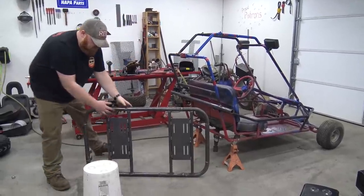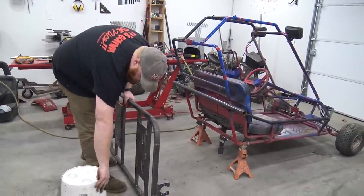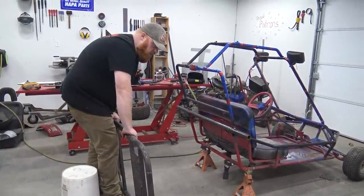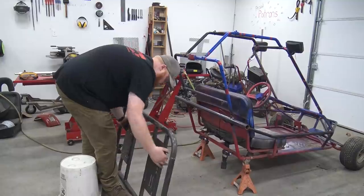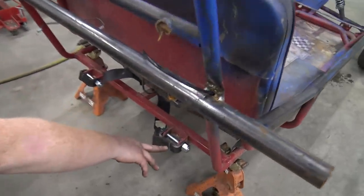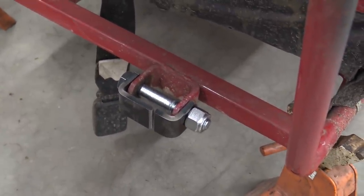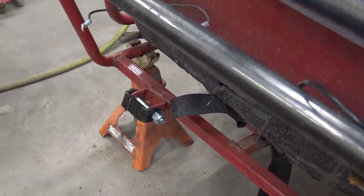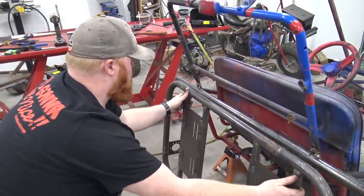There's that engine section — that big behemoth. We're going to put more axle bearings on it, going with four axle bearings total; we only have two welded on there right now. I always put ears on my outer axle bearings because we're going to thrash this thing. For the mount, I took some go-kart spindles from Go Power Sports and cut them down — we're going to weld them back together in the center and weld them to the back engine frame to give a pivot point.